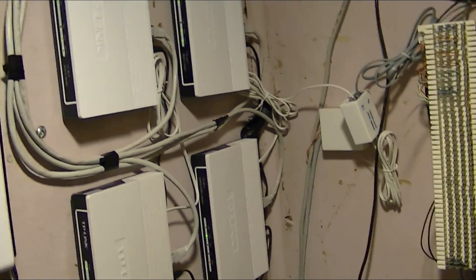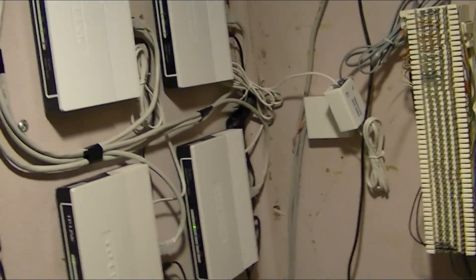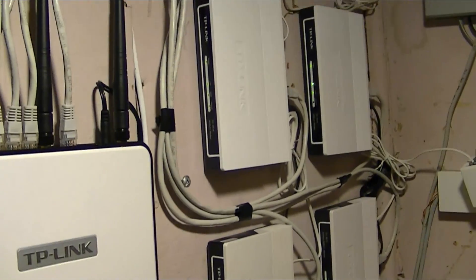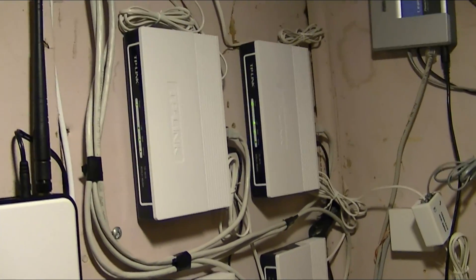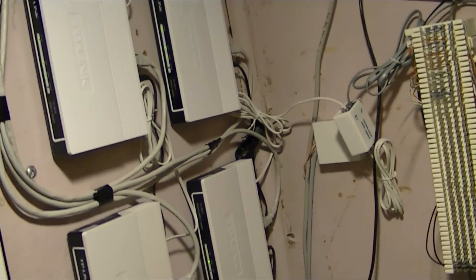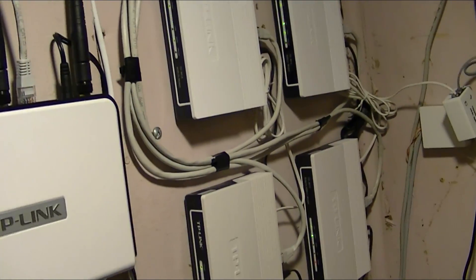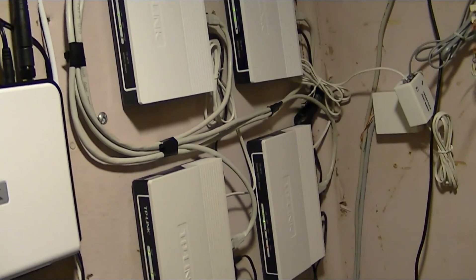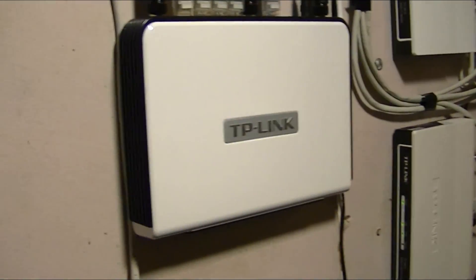So it offers redundancy and allows you to double your speed. If you have two modems bonded together, MLPPP would double the speed and give you double the redundancy. Now theoretically, it is possible to bond cable modems, which they probably will eventually do. But right now, there are a couple of companies in Canada dealing with Multilink Point-to-Point Protocol for DSL.